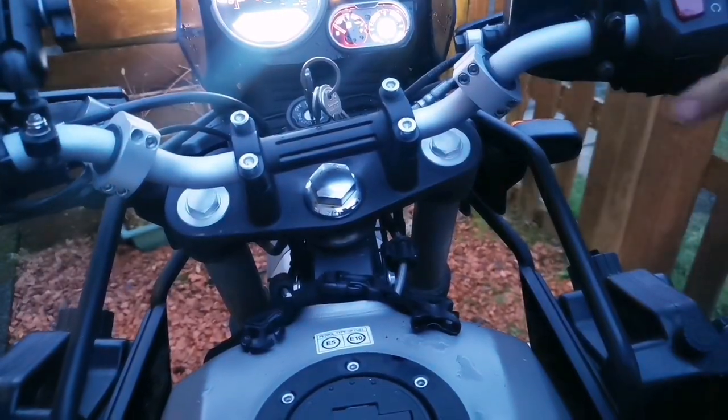However, the bike doesn't need to run forever, yeah, just a couple of minutes. It's still on the centre stand there. We're just letting that oil go up through the system. Then we're going to let it settle again for about 10 minutes, check that level and top it up. And I like to take it up to, you know, just at that maximum fill level.